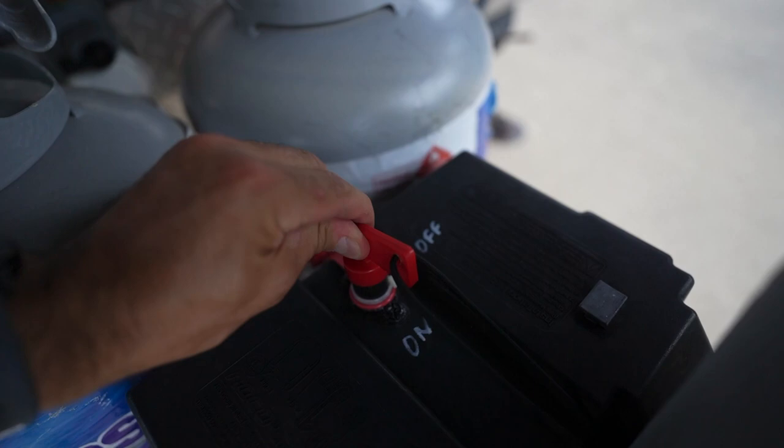So let's jump into actually replacing the old Elixir EXL30 with this new WFCO. They're both 30 amp units. The important thing to note when replacing a converter is to match the appropriate amperage with the new one. It's also nice if the new one fits the same form factor — or slightly bigger — than the old one. The new WFCO is slightly bigger in height and width, so we can accommodate that by making the hole in the back wall a little bit bigger.